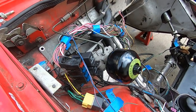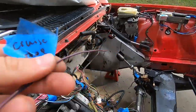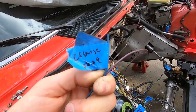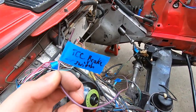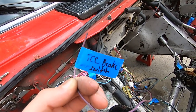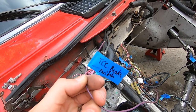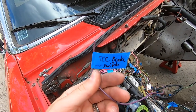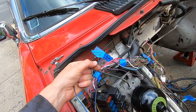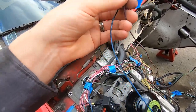Wrapping up wiring — there's one little complexity for this LS swap. We have a wire for cruise stop, where the throttle module is looking for voltage when the brakes are applied. And then we have torque converter clutch brake switch, which works the opposite from how you'd think: the PCM is looking for a constant 12 volts while the brakes are not applied, and then for the 12 volts to go away when the brakes are applied. It's counterintuitive — and strangely, you've got two things looking for the same logic but working opposite from one another. For LS swaps they make switches that have the circuit both ways, but here's what you can do in the Jaguar XJS.